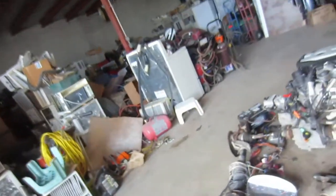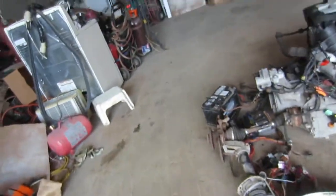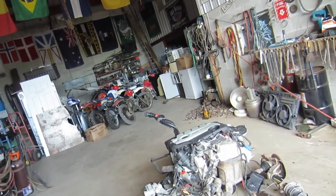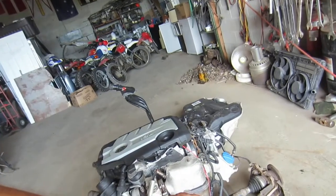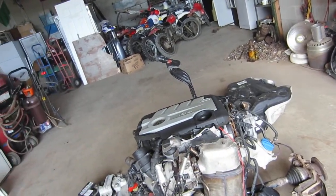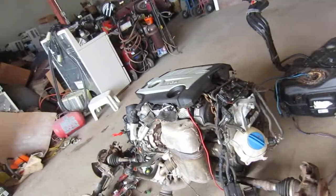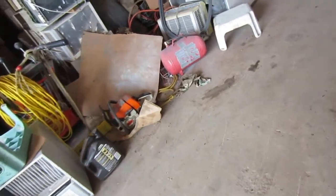This video is also about the speedometer and the static rev limiter. This car wouldn't rev above 2500 RPM while it was parked with no speedometer input. Since I left the ABS system intact, I've now plugged in the module from the car — no hydraulic fluid, of course — and I've hooked up the axles to the spindles, where built into the bearings is the ABS tone wheel, or reluctor wheel. So let's try the speedometer out now.